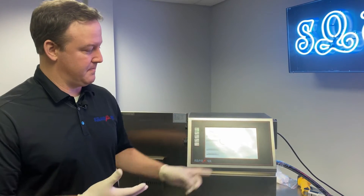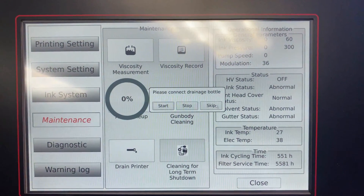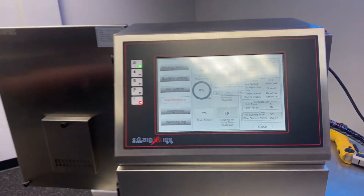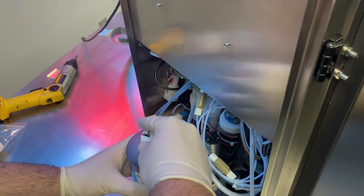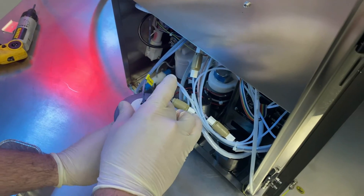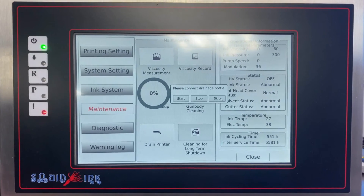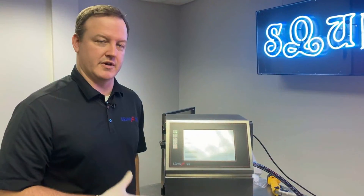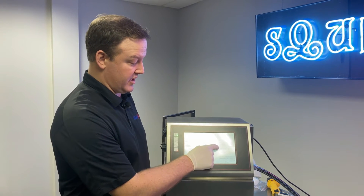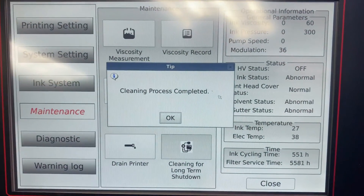The second cleaning process is complete. You'll see the familiar pop-up: 'Please connect drainage bottle.' Hook up the drainage bottle one last time, put the drain pipe in, and start draining. You can let it go to 100% or visually monitor the drain line and click Stop when you're just pushing air. Our final drain is complete — click Continue, and the display shows 'Cleaning Process Completed.' Flushing the JetStream is done.